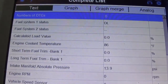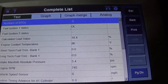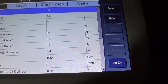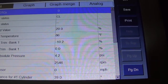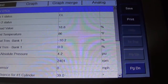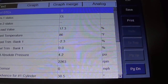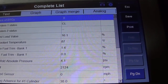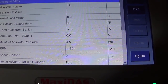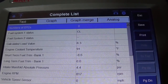Final shot of our data — engine coolant temperature is at 86 degrees Fahrenheit, which is reasonable. Engine's cold, it's warm outside. Start it up and we can see this start to increase. No check engine light. There we go, it's starting to climb. Oh, it's in closed loop already — pretty quick. Fuel trims are decent. Alright, that's a fix.